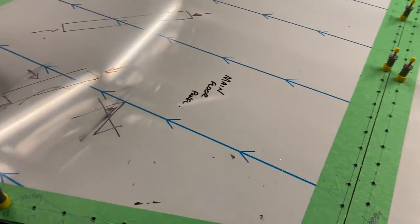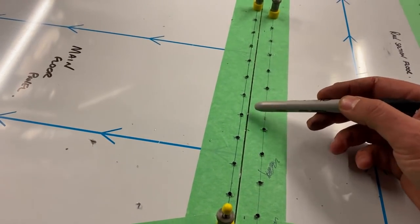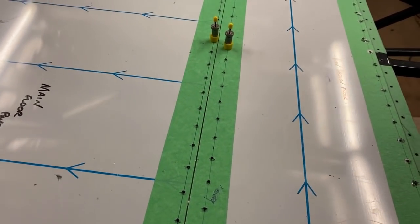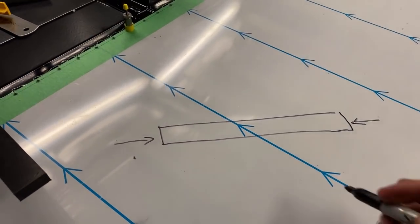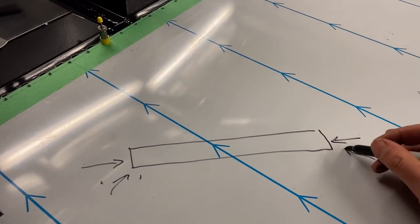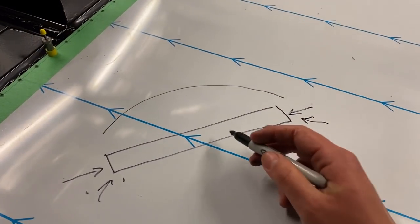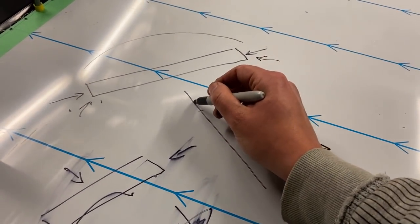The only other thing I noticed when I was drilling these holes is that these two holes are both into the same bit of the chassis. I've offset drilled them, and the reason I think it's a good idea is because if you look at these things, you've actually got some force acting up on them in this direction. What it does is it has a compressive force on that structural member that runs between here, and what that'll actually do is try to make this bend. The stress profile for something like this - if it's bending like this, you're going to have high compressive forces at the extreme fibre at the bottom.